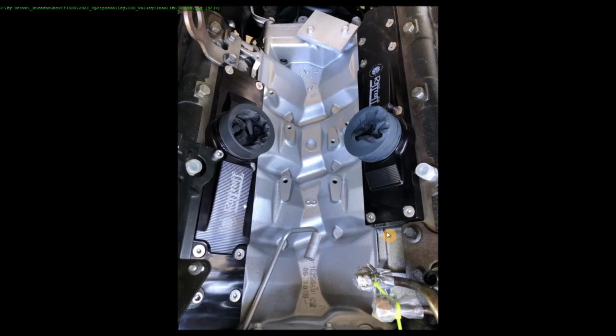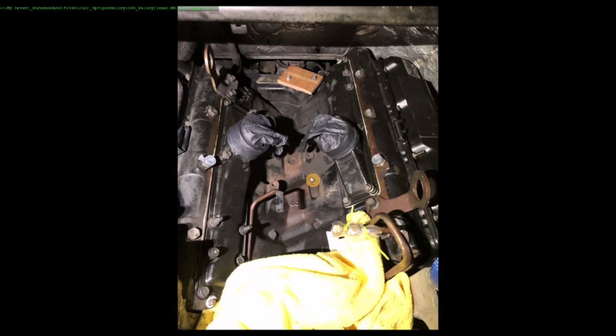I ended up having a little bit of an oil leak from the spider after I got the whole truck together, and it was real nice because I could see there was a little bit of oil down here, and I was like, how the heck did it get down there? And it turned out my factory original boots on the CAC tubes were seeping a little bit. So that's when I ended up getting Riffraff CAC boots for the top by the spider. They're worth it. They're not 10 times better, they're 100 times better. Yeah, so amazing transformation. It's beautiful.